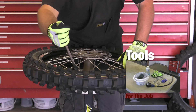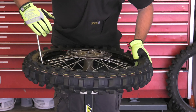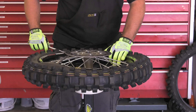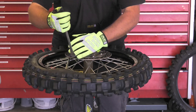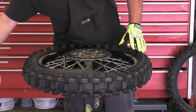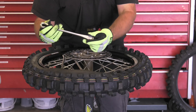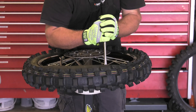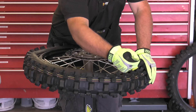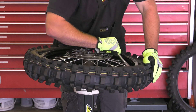You can see our tire is all the way off the bead. Now we'll start just a little ways away from the rim lock and get the tire spoon just in there enough — I don't go in too far. Pull it up and tuck it under the rear rotor, then knock the tire off the bead again with my hands or the tire spoon. I took another bite about two and a half, three inches away. We use three tire spoons; you can get away with less. When you push down, you don't want to go in too far because you can easily damage your tube. If you have a pointed tire spoon — or people try to use a screwdriver — you'll easily damage your tube.